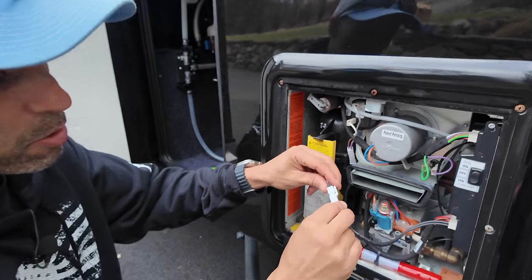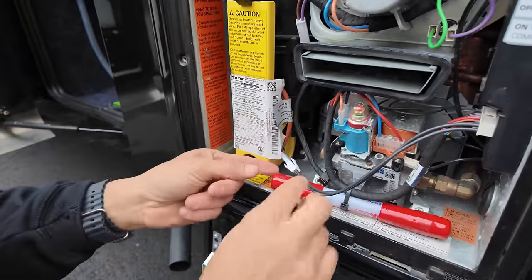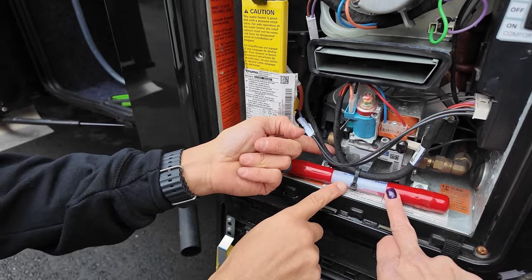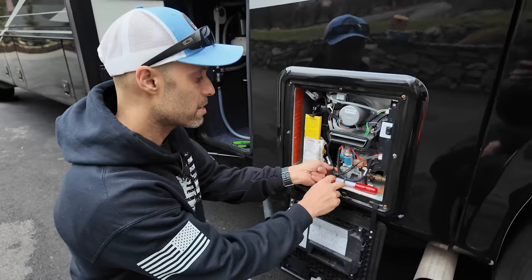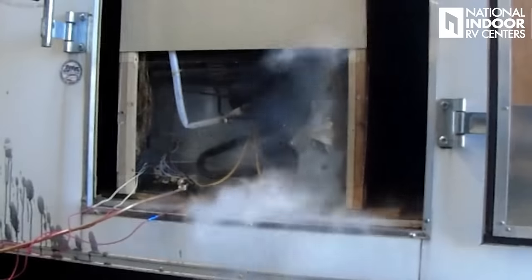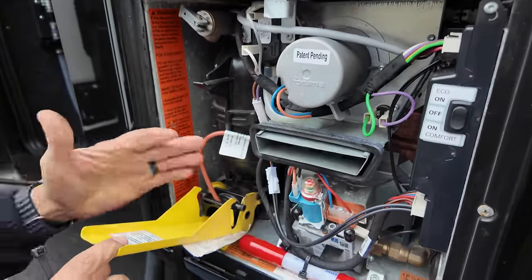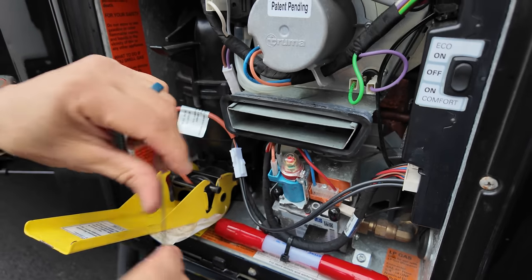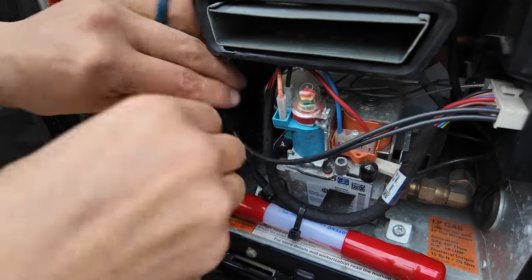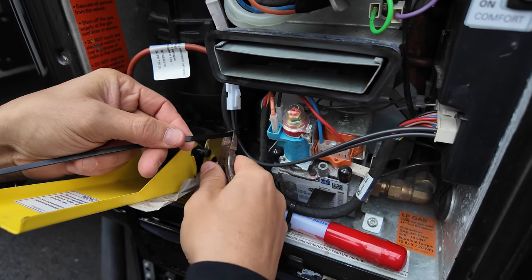Step number four: take the two connections — they only go in one way — and lock them in. Then I'm going to get a zip tie and zip tie this right here. You may be asking what this is — this is a Protang fire suppression unit. The reason we have this here is it's right by the propane lines, so if something breaks out in here, this will kind of explode and put that fire out. Next, I just want to bring the wires up so these connections are up high, because when I open this up to winterize the system, there's going to be water coming out of here and I don't want any of that getting in the wires. I'm just going to zip tie this to keep everything nice and tight. They don't supply the zip ties, unfortunately — can you imagine that for $238? But that's all you've got to do.